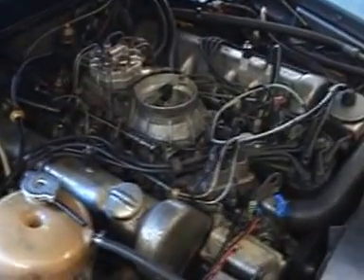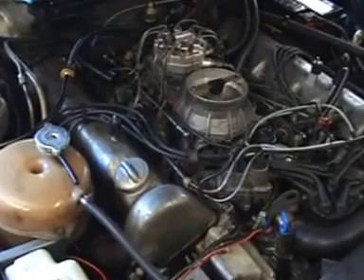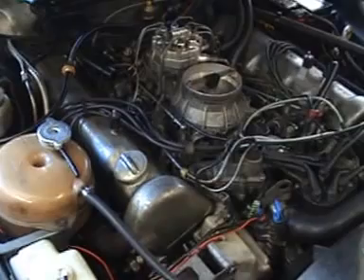I have an enigma. The car was all over the place, completely erratic. You start it, it'll start, and then it'll stop. I reckon the first problem is probably the cold start valve, so I'm going to check that. The second problem is probably the warm-up valve, or it could be some other problem. What we're going to do is diagnose what's wrong with the poor bugger.